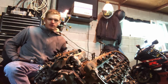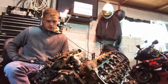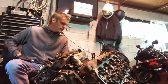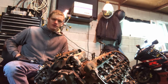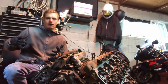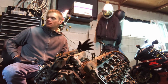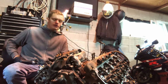If you're allowing it to breathe, it's just running at a much cleaner rate of your engine oil life, instead of that mixing back into your air intake. Another thing is an air intake on the LB7 that's probably recommended. The LMM, it's okay, they're a pretty big air intake on those ones, and it can really make a difference on the LB7 engines, especially with the size of the smaller turbo that is on them. And then as well, getting a tune done on it.